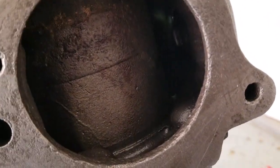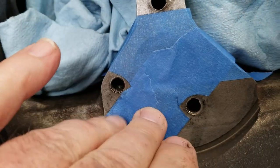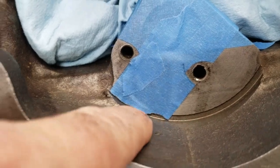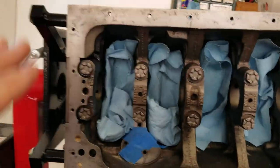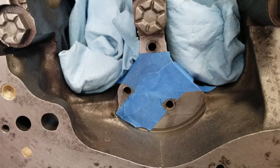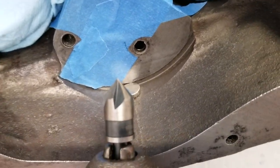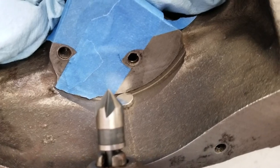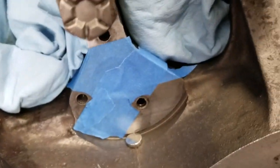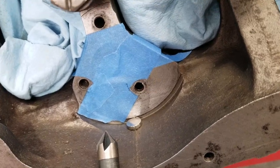I'm gonna go ahead and chamfer those tap points - there's a little ridge on here I'm just going to knock down. I've taped off any of the places where the oil would normally travel to limit the shavings to just this little area. I've set the block on the edge so nothing falls into the engine, and I put some paper towels up in there to manage where the chips go. I'm gonna put a magnet down there too. This is the chamfer bit that goes in the drill - it doesn't have threads so it's not going to go too deep. I put a magnet in the bottom just to catch any shavings so the drill motor's fan doesn't blow them around.